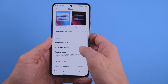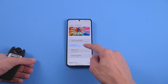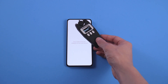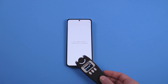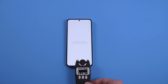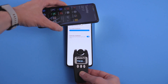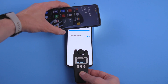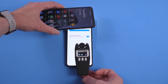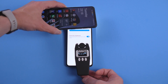Let's check how good the screen is, starting with brightness. I set up the saturated color scheme because it makes the screen brighter. The central part shows 750 lux, the upper part has 770 lux, and the bottom part has the highest result at 780 lux. To check maximum parameters, I use a flashlight from another smartphone to trigger the light sensor at the top of the screen, and brightness increases up to 1000 lux. This is a good result, and the small differences across screen areas are invisible to the human eye.